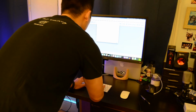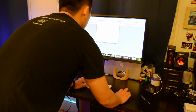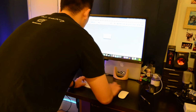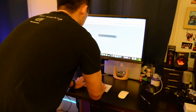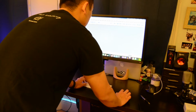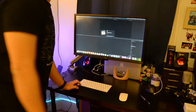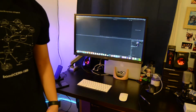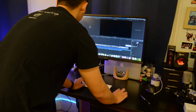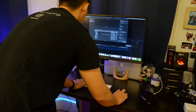And I think if I were to design something that is expecting 4K input, I would focus on having multiple display ports. So there are some workarounds. My Mac does have a mini display port / Thunderbolt port, but I would have to get an adapter and hope that converting the mini display port to HDMI would work. I haven't tried it yet, and I don't really want to, just because I can force the frame rate to be better by lowering resolution a little bit. So it didn't seem completely worth it to me.